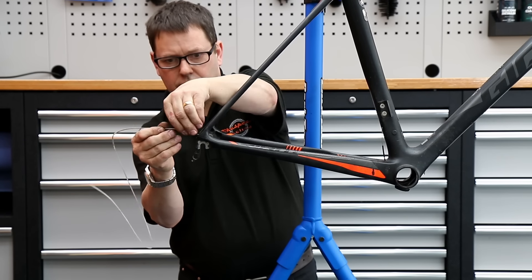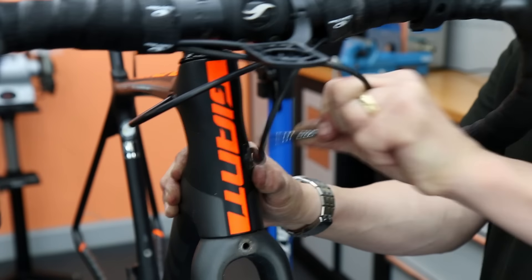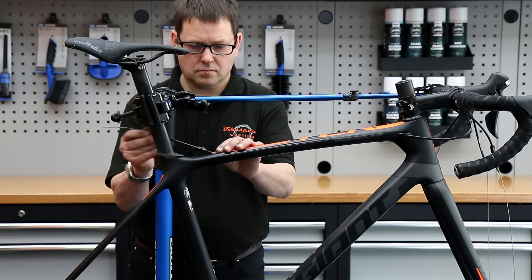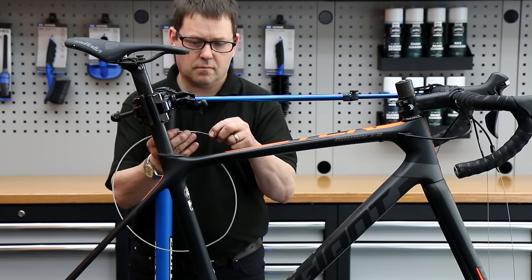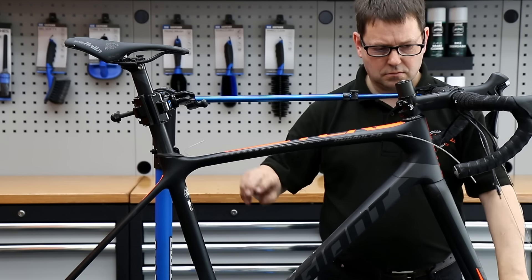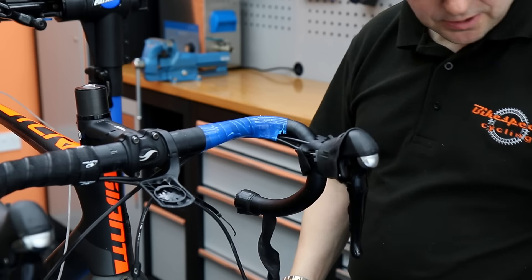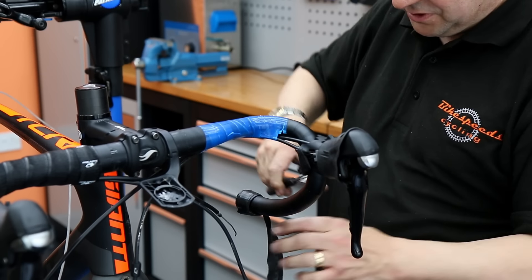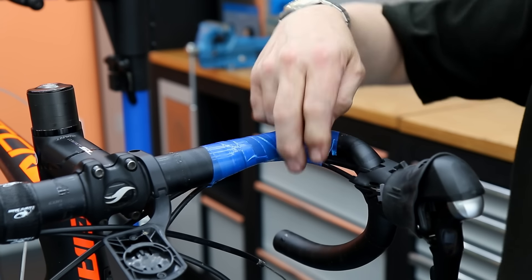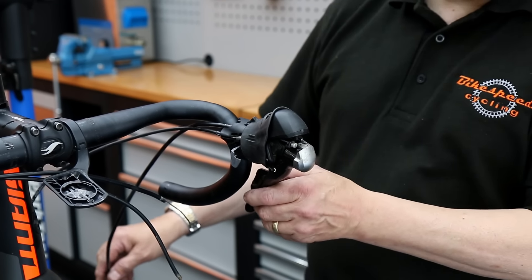I'm putting a cable guide on this cable — although I knew it was broken, I wasn't sure at what point within the frame. In this case we were able to get it right through to the handlebars, which was good. Out come the tails; I put a little cable guide onto that rear brake cable and feed it through the frame. I leave a guide in there to help me rebuild the bike. We're also going to remove the handlebar tape and replace the outers right up to the shifters themselves. The bike had been tipped over and had damage on the bar tape in multiple places.